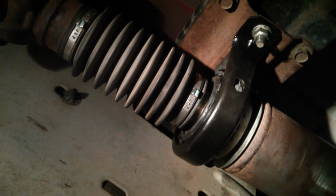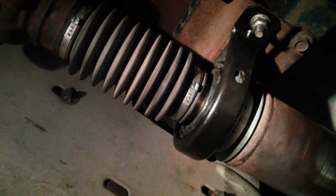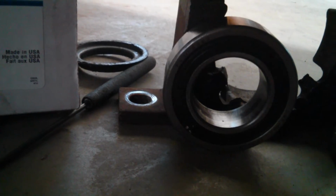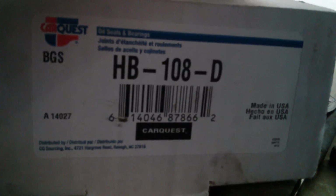And this new one came from a local parts house, and I'm not sure what its application is, but the one that I purchased online was the incorrect one. So before you start this project, I highly suggest that you check and make sure that the bearing in the one that you have purchased is 40 millimeter ID. Again, 40 millimeter ID.